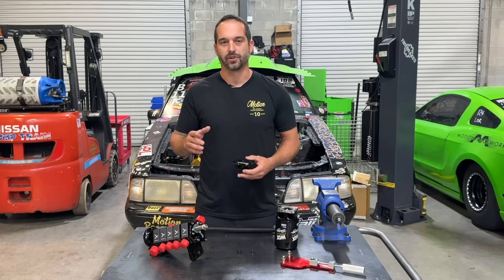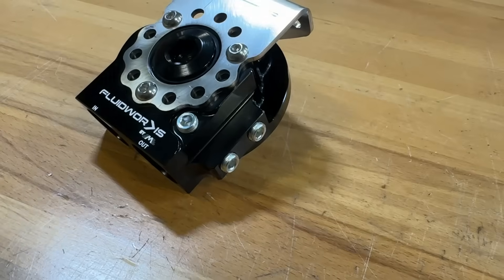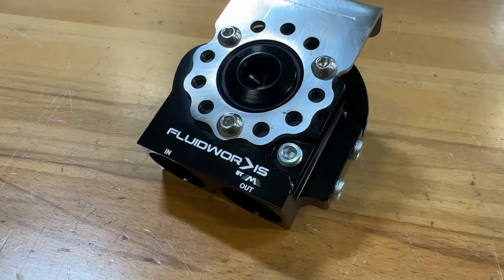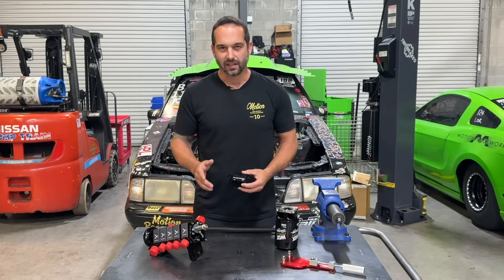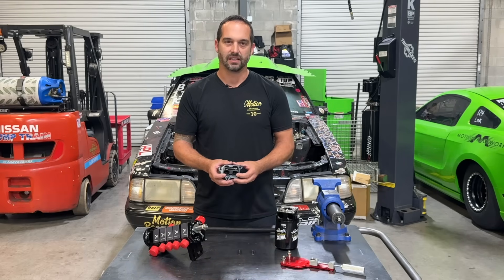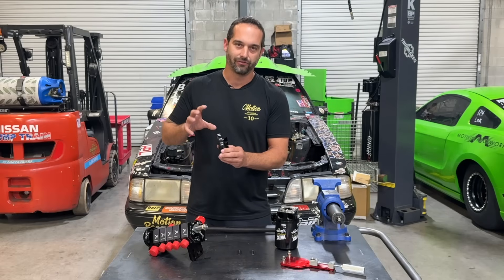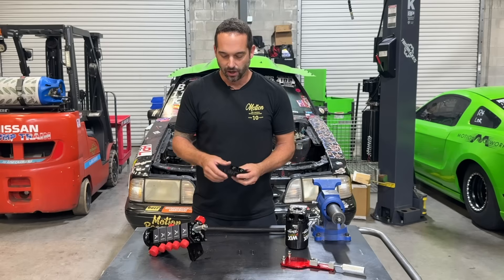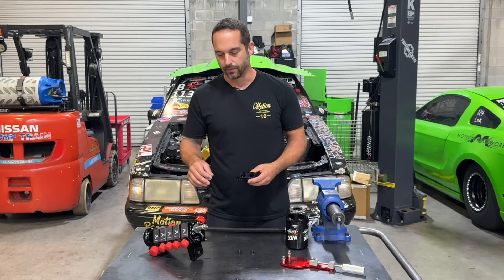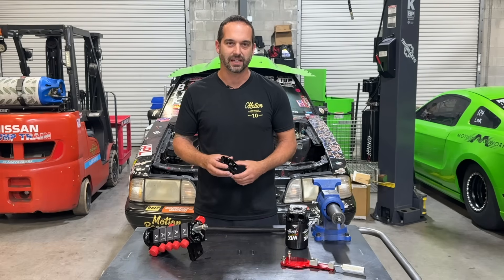Oil system components are marked in and out — on the filter housing, on your dry sump pump — and these labelings correspond to oil flow. I've seen a lot of mistakes made in the past with running lines from your engine to your filter or from your pump to your filter. You just have to think about it for a second. This piece here is for a Coyote — a Fluid Works part that goes on the engine block where the factory oil filter housing goes for a remote-style filter. You'd use this with a dry sump system or a factory oil pump. All of these components can be used together or separately. That's why they're labeled in and out rather than A and B. This system has been around forever — just think about where the oil is flowing.